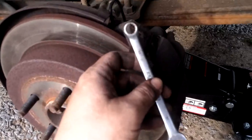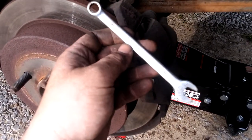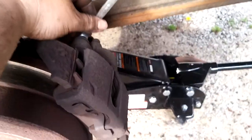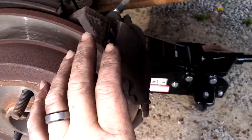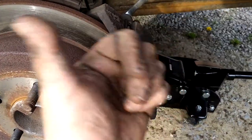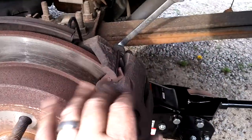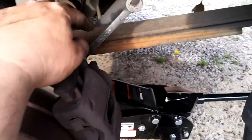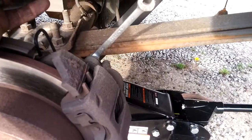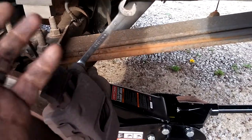What I like doing is taking your basic little wrench — it's a 10 millimeter wrench, it's Task Force, very old, used to come from Lowe's, had it for years, still works fine. You fit it on there. Now if you're looking at it facing you, righty-tighty that way, then it's lefty-loosey facing you — just remember that. Take your ball-peen hammer and just barely peck on it a little bit to loosen it up on each one, and then you can take your thumb wheel ratchet with a little 10 millimeter socket and twist it off by hand — easy peasy.